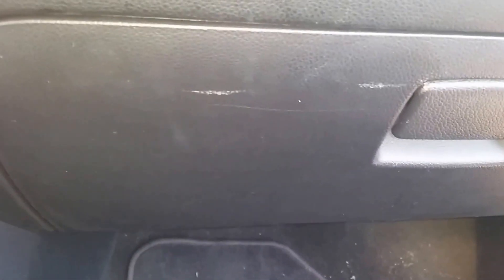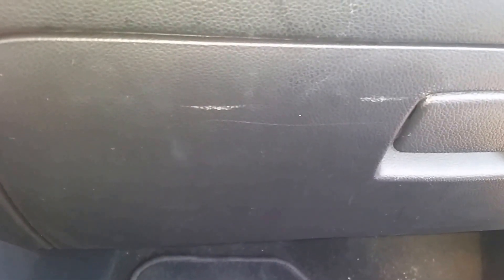Today we're going to figure out how to change the cabin filter in a 2012 Kia Sportage. This is the glove compartment, and inside there are these two little knobs. According to what we found out, these knobs should come out — put that aside — and the other knob flips down.